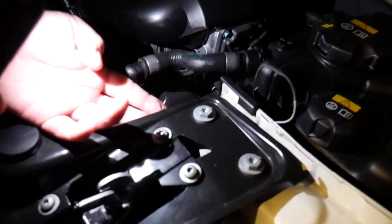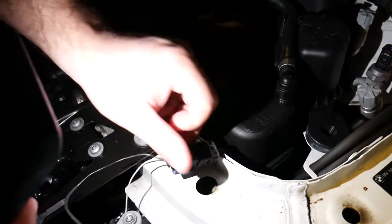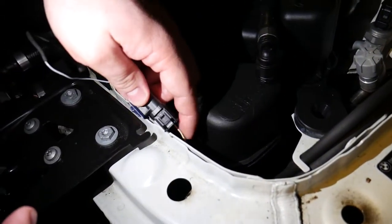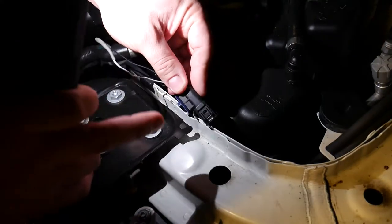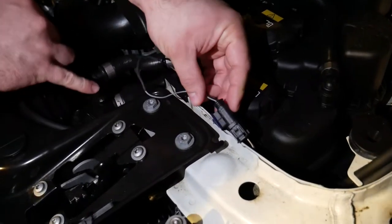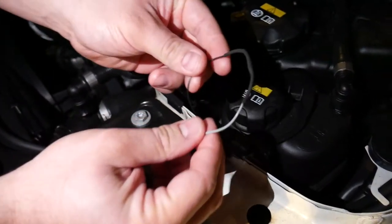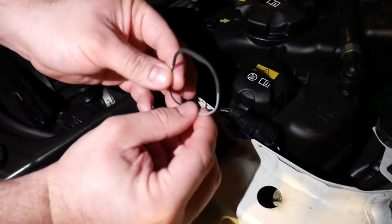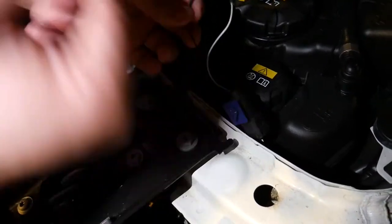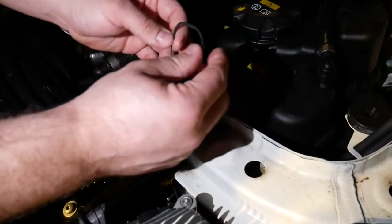What I did was I cut the wire from the sensor back here — you can see it. These wires lead to the micro switch which is back here, those wires wrap around and connect into this side. Do not cut anything from this sensor on this side because this belongs to the harness for the car — that's expensive to replace. The original wires go to that sensor; what I did was I installed a 7.5 kilo-ohm resistor to the circuit, so basically it's faking the proximity sensor and telling the hood that it's closed. Whether your hood is open or closed, the resistor's there and the computer recognizes it as the hood being closed. Really simple fix — there's only two wires.